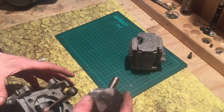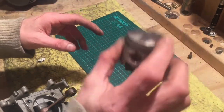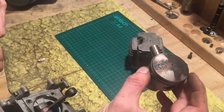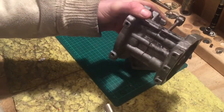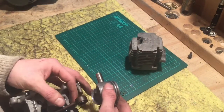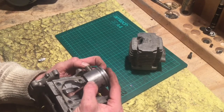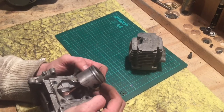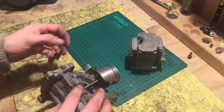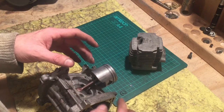So you would take your new piston, which wouldn't have a wrist pin in — it would come in a bag and you wouldn't know which way was which. So you look on top for the identifying mark, which is here. That lets you know where the exhaust blows out. So we look on the engine for the exhaust port, and we want the arrow facing the bottom of the engine — that's the way it's going to go on. Then we pop our pin back in by wobbling it backwards and forward until it seats, and push it all the way through until it touches the other spring. On a new piston that spring wouldn't be there, so when you get your new piston shove one of these springs in — I'll show you how to do that in a minute.